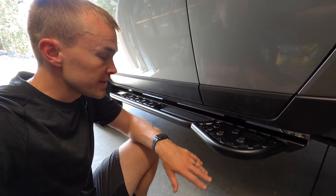Installation is really simple — you've got eight bolts, a 13mm socket wrench, and a floor jack, and you can get this done on your own. If you've got a second set of hands it'll probably take half the time to get it in position and get them screwed in. On the passenger side you can see the uninstalled slider for comparison — the underside, the top side, and the cutouts with the mounting plates on the chassis. Eight holes, and that's it.